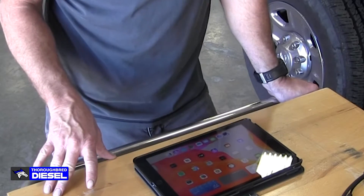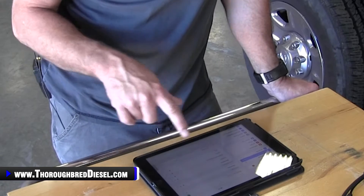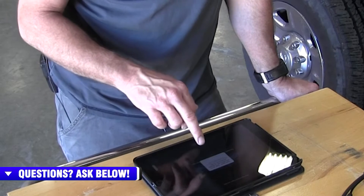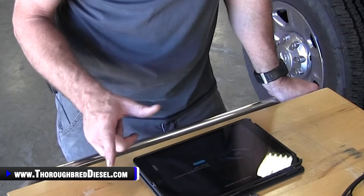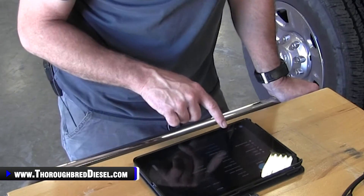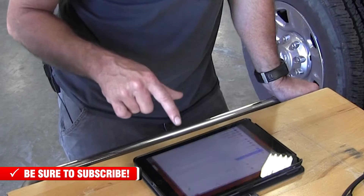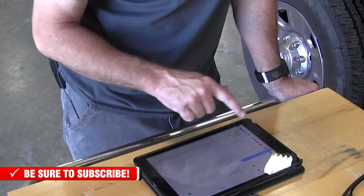With the truck on and key on, everything hooked up — first, we're going to go over to our settings and pick the EZ-Link as a WiFi connection. Then we go out to the EZ-Link app, hit Auto Agent, and it will find networks on our device. You will need an internet connection to check for updates, so we go back out to settings, come off of EZ-Link, and go back to our normal WiFi connection. Then back to the EZ-Link app to download the firmware.